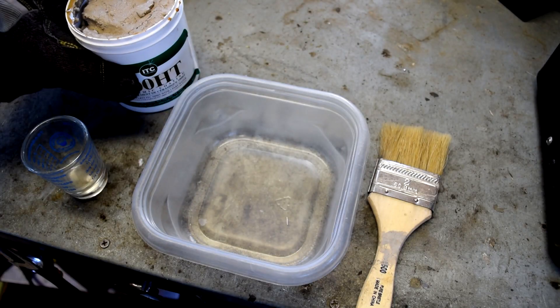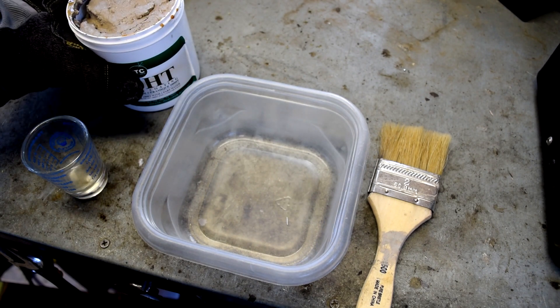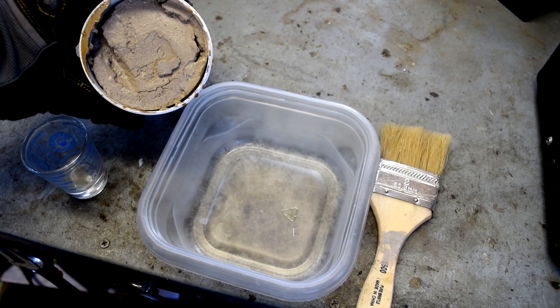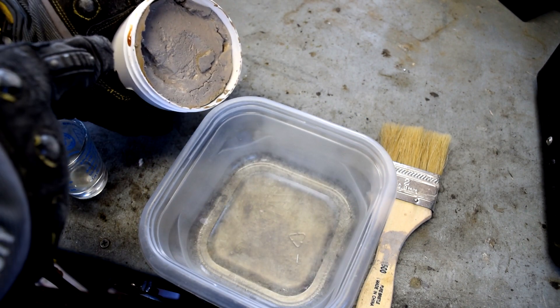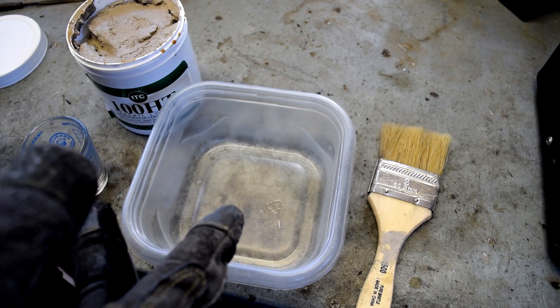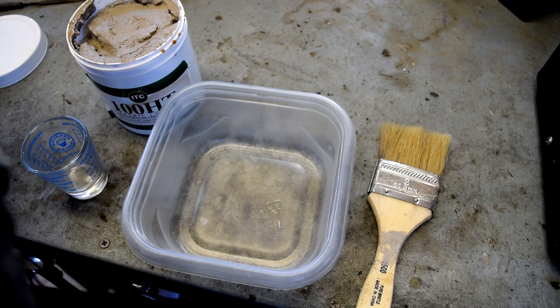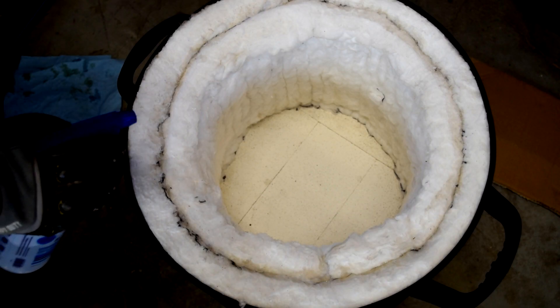Then we can put that 100HT ceramic coating on and we'll be about done. Let's go ahead and mix up this 100HT ceramic coating — I got this off Amazon, it wasn't cheap, I want to say it was $30 or $40. It comes in looking like sewage, pretty much, and it doesn't smell too great either. You're supposed to mix it two to one — two parts 100HT to one part water. I have some distilled water so I'm just going to use that. Don't add anything else to the mix, and then we'll start painting it on.